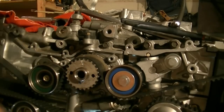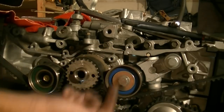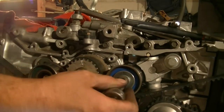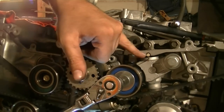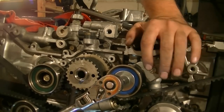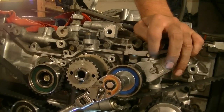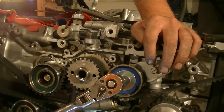I've got my nail ready — just going to put it through this hole and the hole in the piston, and once this goes up enough it pushes in and locks it in place. You want to do this as slowly as possible. You only need to turn this maybe a few millimeters, but you want to do that as slowly as possible — definitely don't crank on this hard at all, otherwise you risk damaging the hydraulic tensioner. This is all if you're going to reuse it.